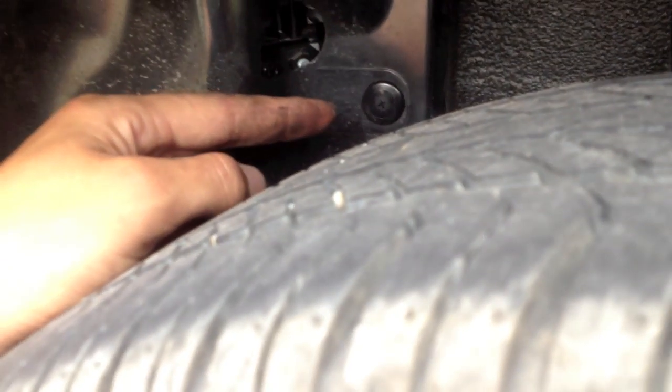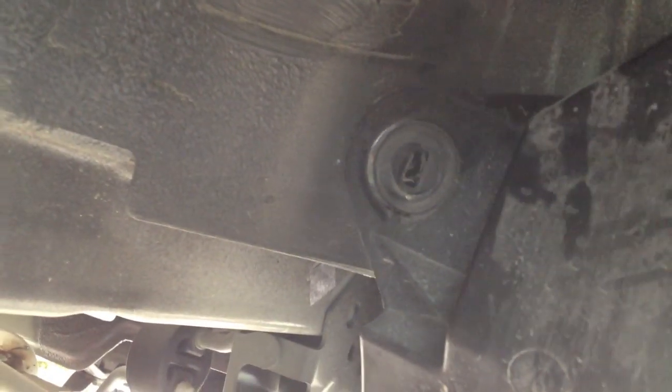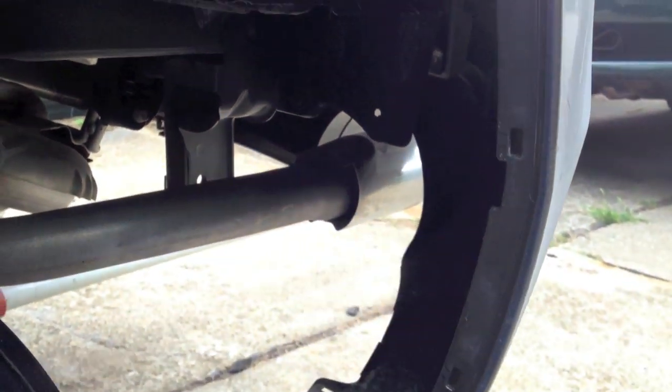For the rear on the passenger side it's a little bit different — it has a second inner fender that covers the fuel pump. You have one fastener there, one fastener up at the top, and then the actual screw in the middle goes on the outside and screws the fender to the other fender on the inside, and then that'll come right out. In order to get the inner fender out, pull it off the stud that sticks out of the wheel well, then these two little clips here will just clip right off — pull towards the inside of the car and it pops right off, leaving the bumper cover exposed.